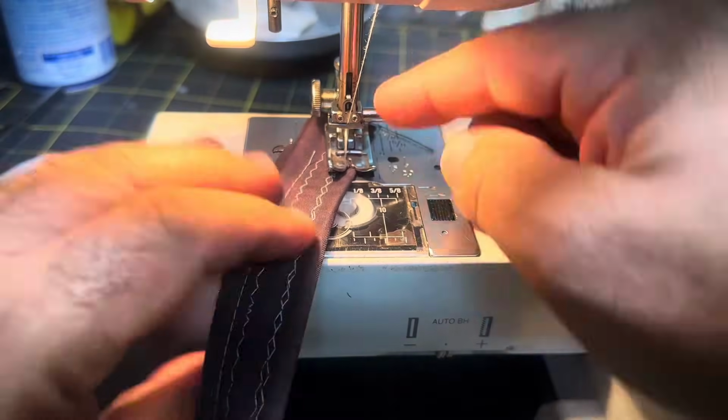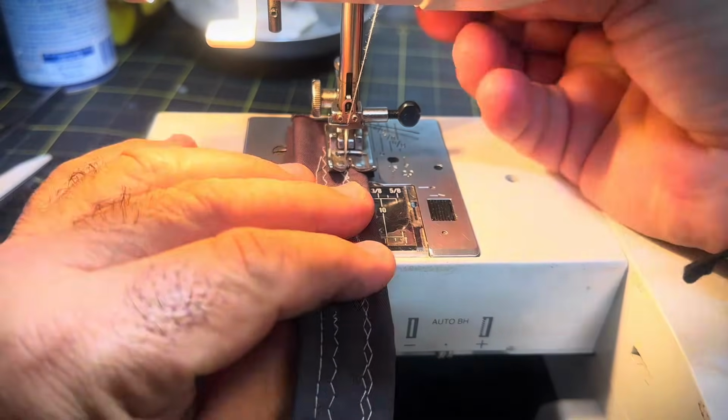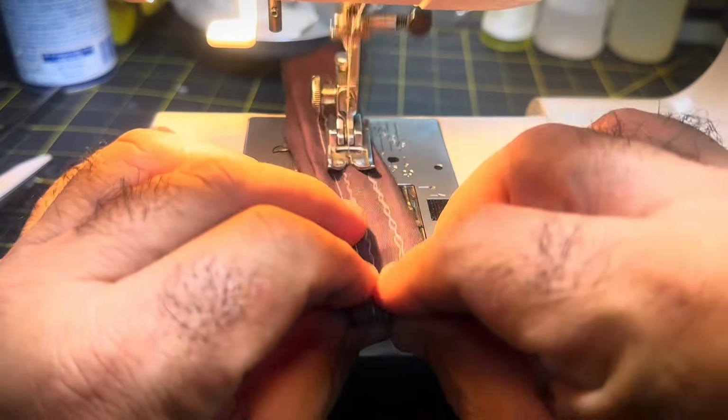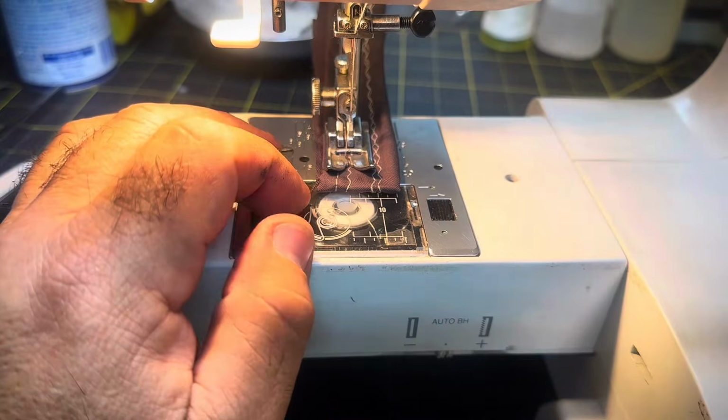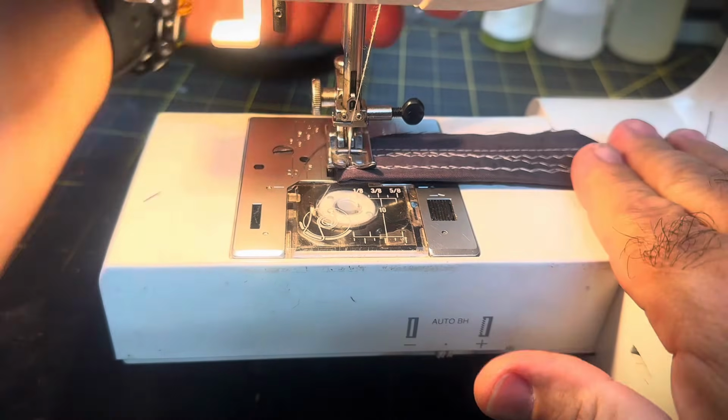the problem with this machine was not that the reverse was damaged like the customer thought it was. It was just that the feed dog height was too low and didn't even let the machine work perfectly. Now everything was good. We just made another happy customer. There you go. The machine is perfectly fine now.